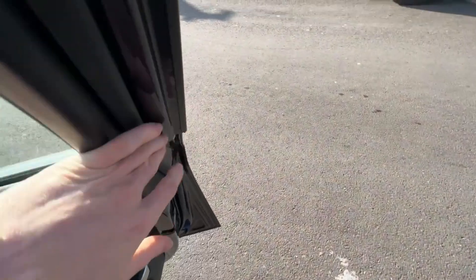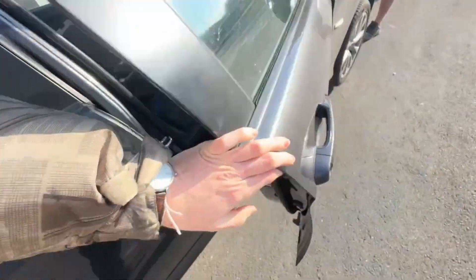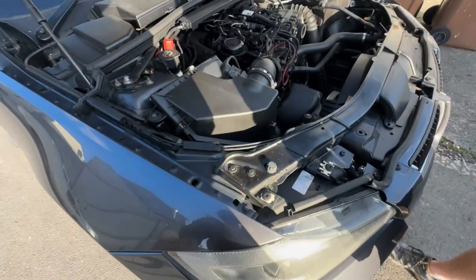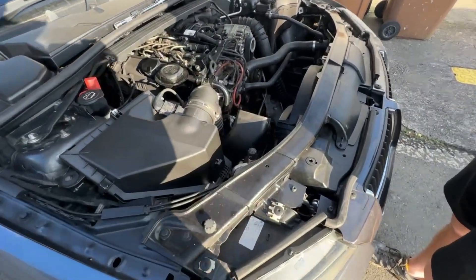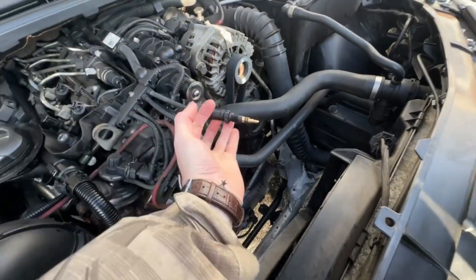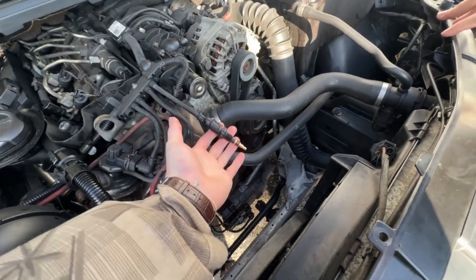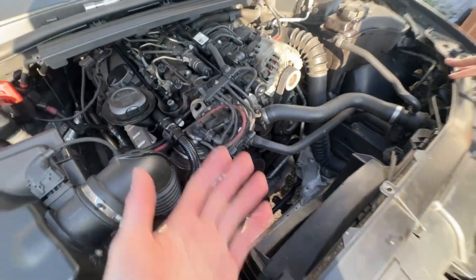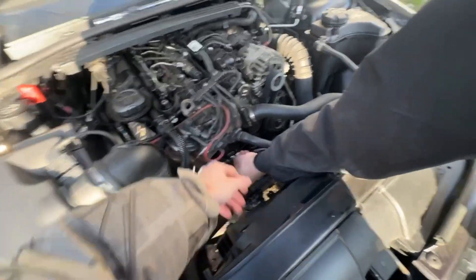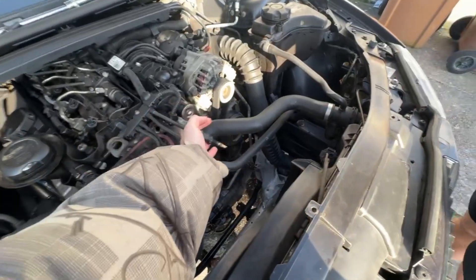So that's how you fix your BMW N47 engine. Make sure to check the engine when it's cooled if you've got any coolant issues or heating issues. Before you change the water pump or thermostat, it's easy to test — literally unscrew the sensor and see if it says 110 degrees when the engine's cold. If it does, it's clearly an issue with the sensor, so replace that.